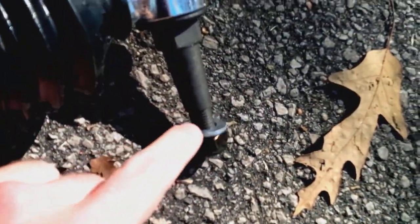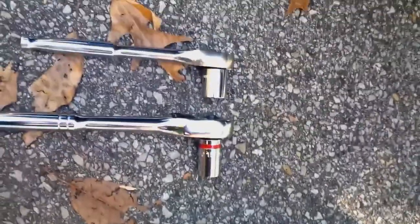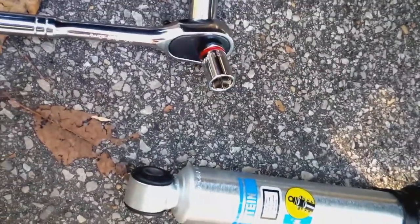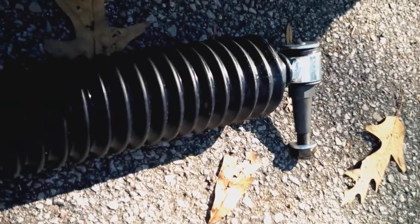This end came with a new nut and washer; this end did not come with anything. You'll need a three-quarter or half-inch ratchet with an 18 millimeter, or a half-inch ratchet with a 15 millimeter. You've got to use two to get the left end out. The right end is the 18 mil — we'll find out in a second. Maybe you'll need some PB Blaster.